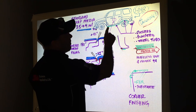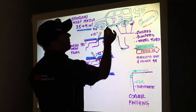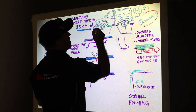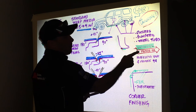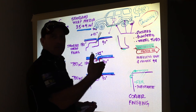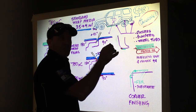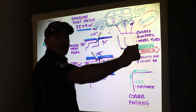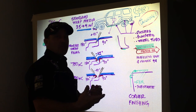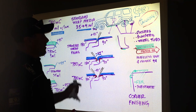You're going to do that along the rocker, you're going to do it in the wheel tub, and you're going to do it on the bottom side of the bumpers. Run your knifeless, and run a bead of Primer 94 along your knifeless — along the rocker, under your wheel tub, and again on the bottom side of your bumpers. Your Primer path is going to be along, but not on, the knifeless tape. When you're finished, you're going to have a nice, clean cut — you're not going to be cutting into the paint, you're not going to be cutting on the vehicle. The knifeless tape gives you a nice straight edge to follow with your Primer 94, knowing that's where your finished edge is going to ultimately be. It's only going to fortify and help sustain that wrap longer, especially in harsh environments like we have in the Midwest. That's probably all I have in terms of cutting and finishing — thank you for watching.